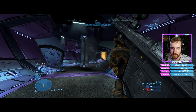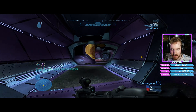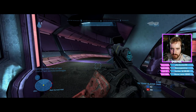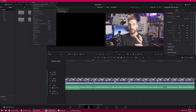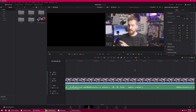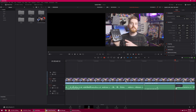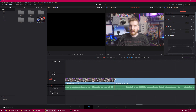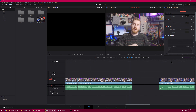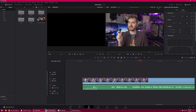The graphics card in this is a full NVIDIA RTX 2070, which has 8 gigs of VRAM and enough graphics power to game, stream with NVIDIA's new NVENC encoder for Turing — which is very high quality — and video edit with CUDA acceleration. More than good enough for virtually anything you throw at it: Premiere, Resolve, all of that stuff, especially if you're editing at 4K or lower. If you're starting to do 8K stuff this might get a little wonky, but especially in a program like DaVinci Resolve where everything is offloaded onto the GPU, this is great for it.